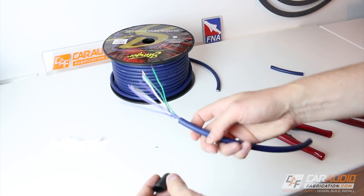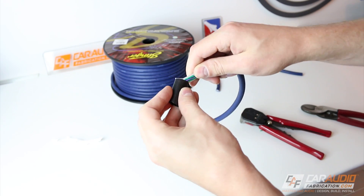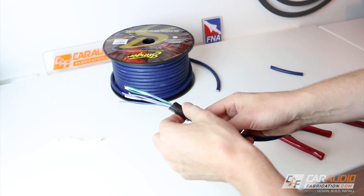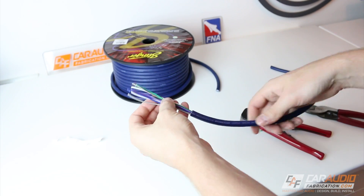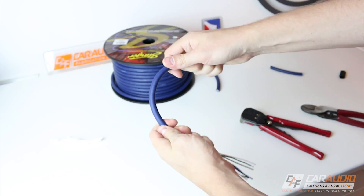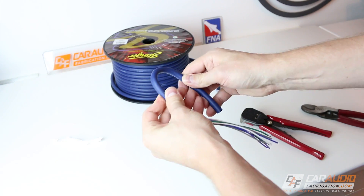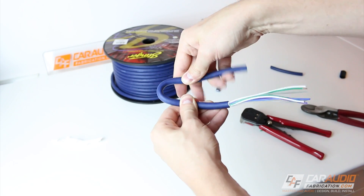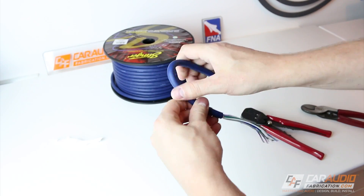As an added final touch, you could actually put a little piece of heat shrink on here and heat shrink it just so those ends are terminated a little bit better. What's awesome about the speed wire is just the fact that you have literally nine wires contained within one easy, convenient package, and it's literally super flexible. You're rarely going to need to go that tight of a bend in a vehicle — maybe 90 degrees, but not 180 — and there are no problems there.